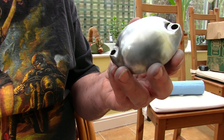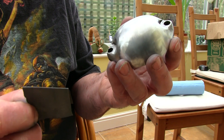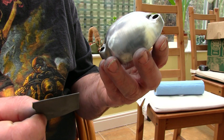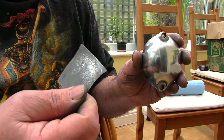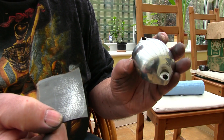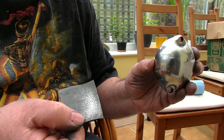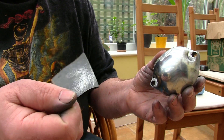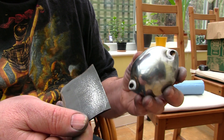I'm rubbing a piece of aluminium with paper so I won't do more commentary on the actual paper stages, but the full sequence is 600, 1000, 1500, 2000, and 2500 wet-and-dry paper. What is remarkable is that you can now see there's actually shine on the paper itself, so it's having a polishing effect. So far I'd be happy with that on my bike just with the paper to 2500 — just dry — it's beginning to get smoother and smoother and is now polishing the metal.